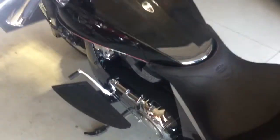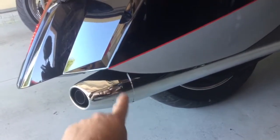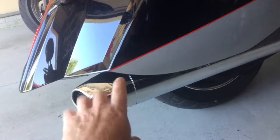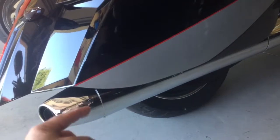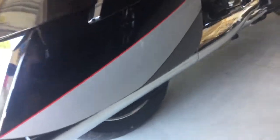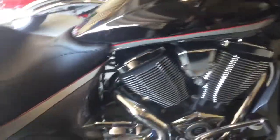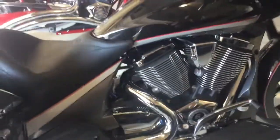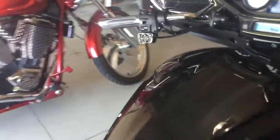Okay. So yeah, you get these things, it's just got stock exhaust, somewhat. But what I did is, I pulled the exhaust off, took the tips off, took a cut-off tool, cut the back end off, pulled the guts out, pulled the baffles out, and then welded the back end on. And then I also put about 6 holes around this exit pipe. I also did the Lloyd's air cleaner underneath there, and so then you get a little pop once in a while in first gear when you're shifting. So I did the Lloyd's fuel tuner, and well, I'll let you hear what it sounds like.